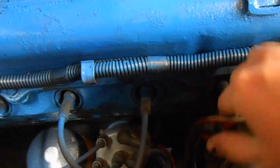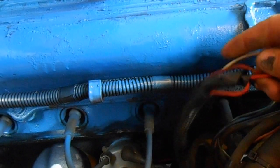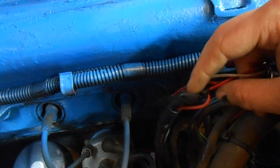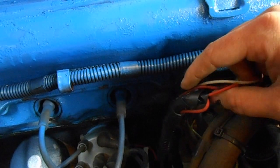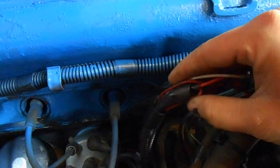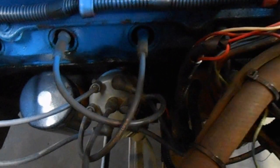Some other wiring you have to use is the ignition trigger wire, which I covered most of mine up with protector. Yeah, I got a little overspray on it, not too bad. I just wrapped this. It has a heat-proof, waterproof connector in it, and what I did was I tapped the ignition wire that runs from the factory ignition into that, as well as also connected my PerTronix electronic ignition on it, since I converted this from a point system to magnetic pickup.